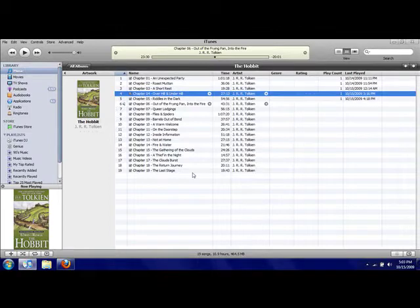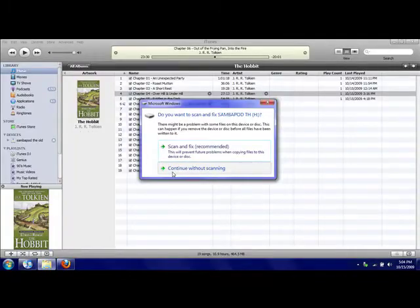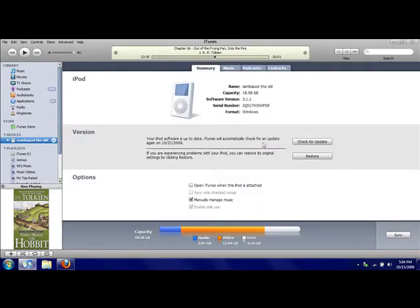I'm over here on my computer and I've got iTunes open. I'm going to go ahead and plug in my iPod, which we just put in disk mode. The computer should find it and load the drivers. iTunes has found it and it's already in restore mode. You won't have any information showing because there won't be anything on your drive. Sometimes you'll have to re-put it in disk mode — if it says sync mode at the top rather than disk mode, you're going to have to re-put it in disk mode. Right now we're going to hit restore.